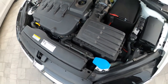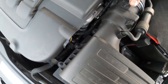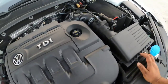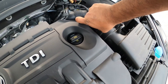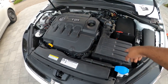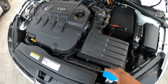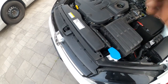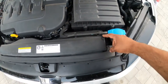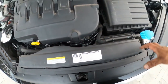So how are we going to do that? First things first, we're going to unplug our MAF sensor. It looks like it's a pull tab — I'm going to figure that out in just a moment. Then we're going to pull that off, unscrew the Torx screws around the airbox, which gets us the top half open, anything underneath holding it, and then this line here is going to have to move out of the way. It looks screwed in here and here.